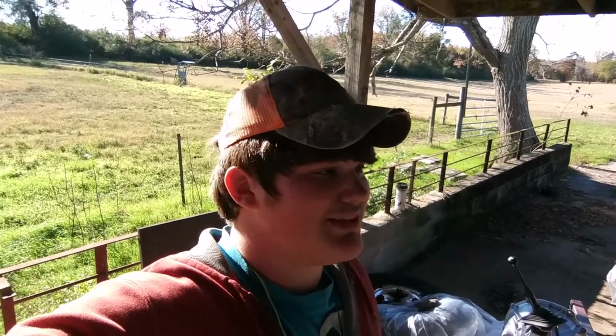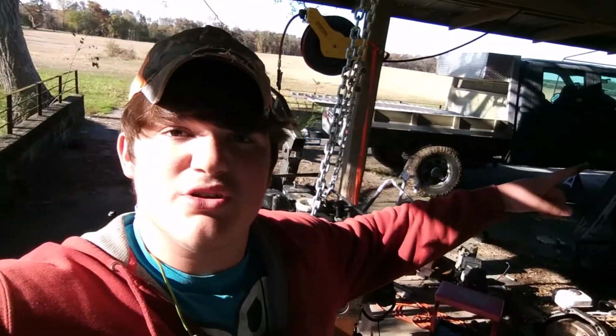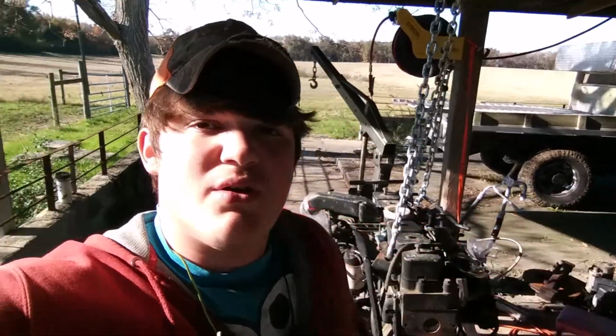Well, another part of the video for y'all. Another couple days for me. Well, a couple weeks. But I told y'all in an earlier piece of this video that we found out the transmission in that truck won't work because it's a gas manual transmission. The bell housing's smaller. I had to get a custom flywheel, and it just wouldn't work.